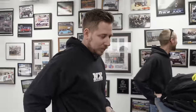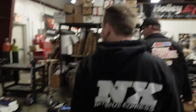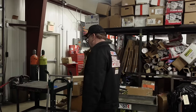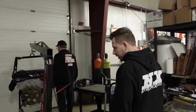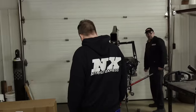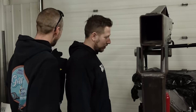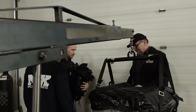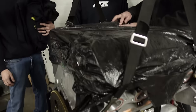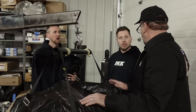All right, let me get these guys loaded up. They got you ready, they got you on a cradle too — it must have had your name on it. Is one of your 959s too? Yes it is. I was going to take you back and just show it to you and put your name on it. We're just going to start selling stuff. I hope we look at these valve covers — they should be okay. What we did is we welded a solid plug in there and clearanced it out. Now it's got two long studs in both of them.